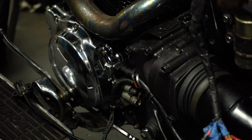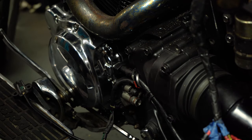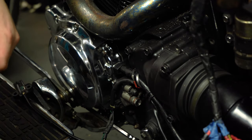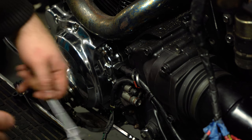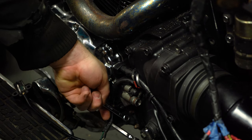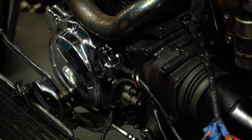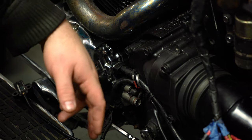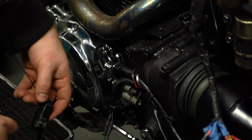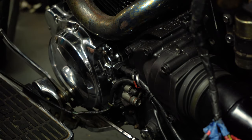If you haven't taken off the side casing yet, you will need to do that. It's a few bolts on this area and the chrome side casing will come off. If you've never taken this side cover off, there's a few things in here you might need to know in the future. Number one is that this is your neutral light switch down here - if your neutral light switch isn't working, it could well be this sensor that's gone bad. We also have the bleed nipple, the gear shifter that goes into the gearbox, and a cable coming out from the stator. And we've also got this little beauty, which is your kickstand kill switch - I've just installed a new one recently, that's why it's not actually attached yet. This does obviously have to be attached to your footboards or foot pegs.